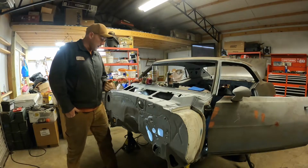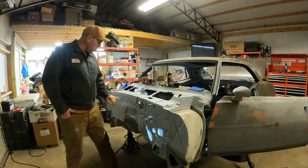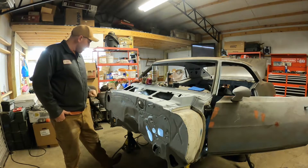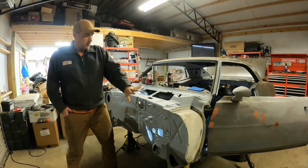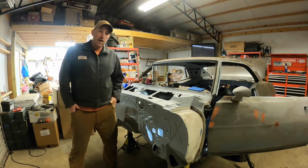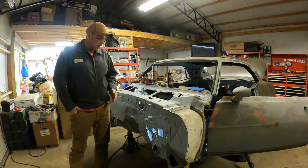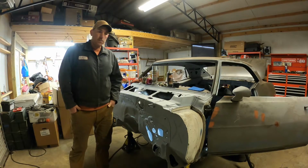Coming up in some of the next videos I mentioned before, we're going to be seam sealing my firewall, and then I'm going to put a little body filler on here, try and smooth it out a little bit, and sand that down, and then we're going to paint this front part of the firewall, and then we'll get back to the underneath side and work on that. I'm going to put a Raptor liner on the whole underside, and I want to bring you guys along for that.